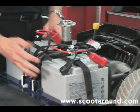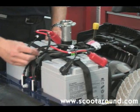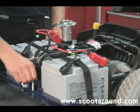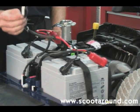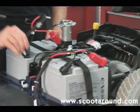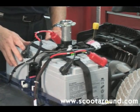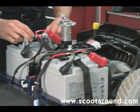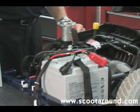As we pull the cover off, we now have access to our two batteries. As we follow the cord around, we find that the plug is right at the very front of the scooter — we reach down and grasp it near the plug and release the little black-and-white plug. We follow the other battery down to the same point and release that as well. Now we have disconnected all power to the scooter. We have a strap across the top of the batteries and two little handles built into the battery itself that allow us to lift them off and set them out of the cart.